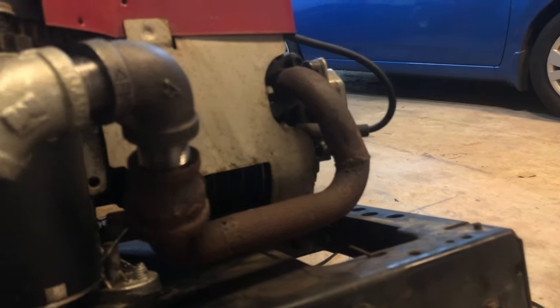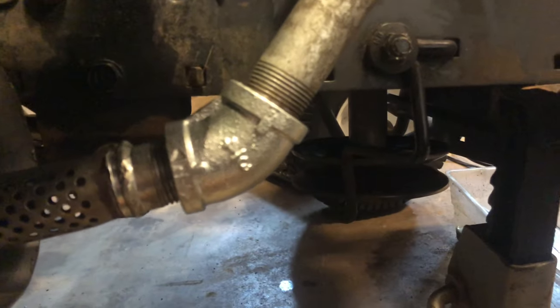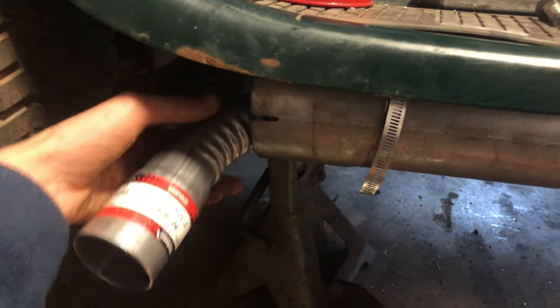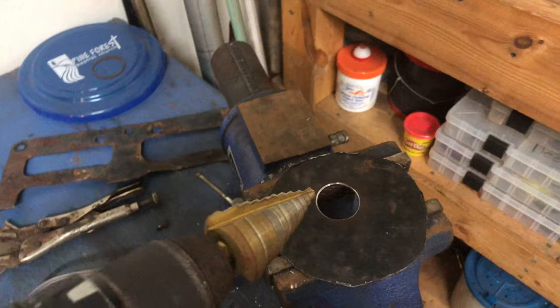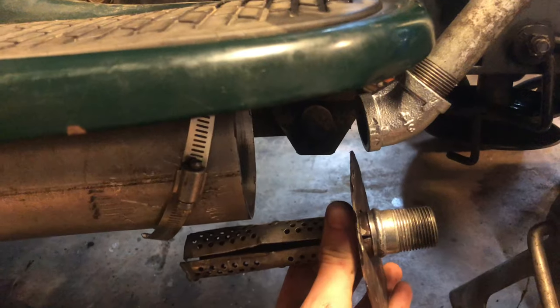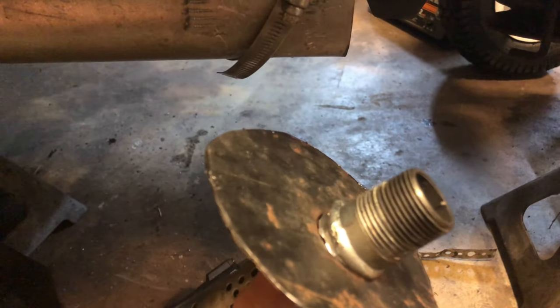So a little bit of transformation - I got new parts and it took a lot of trial and error. I got the pipe running up there, running down this pipe to a broken-off Briggs and Stratton muffler with the centerpiece knocked out, into this resonation chamber Duramax exhaust four-inch pipe. I bought this little piece from Advance and that's going to roughly go in there. So I got my hole drilled out now - I was using a step bit here. I'm drilling through something thicker than what this is supposed to handle, but it's all I had and it seemed to work alright. I could in fact put a muffler inside of a muffler. Basically this piece is going to get welded onto that and this pipe's going to stick through it - check that out, it came out almost absolutely perfectly.